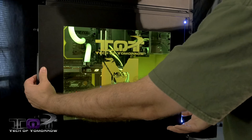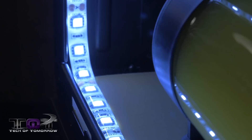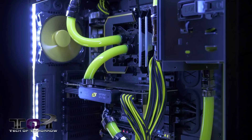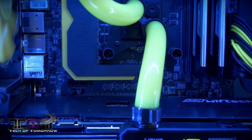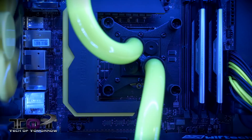Now let's start taking the system apart to show the components everybody really wants to see — the actual guts of the Metro 935. Removing the side panel, you can see all of the UV lighting. These UV lights require no ballast. Everything inside follows the yellow and black theme of the Metro. To get those colors, the tubing used is PrimoChill PrimoFlex Advanced LRT tubing — half-inch ID by three-quarter OD. We used 10 feet of it; it's pearl UV yellow, part number PFLEXA10-34-PUY.